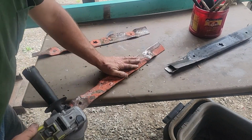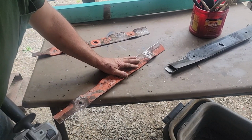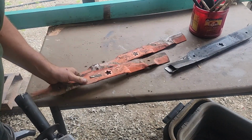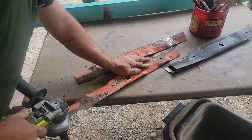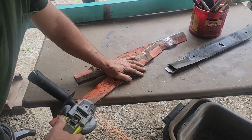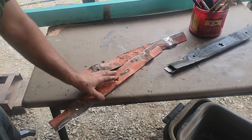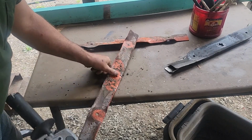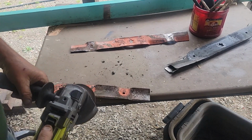On the back side, I just flatten it out, see if there's any kind of stone burrs or anything, you know. We're up here in stone country. And then I'll sharpen the front side. Try not to overheat it. I'll put it on time lapse,